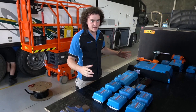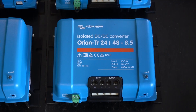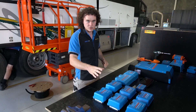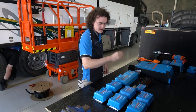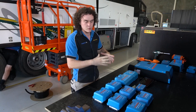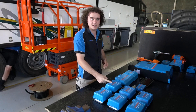We've got heaps of blue Victron gear right here. We have not one, not two, but three DC-DC chargers. They'll be taking the 24-volt alternator up to the 48-volt battery system. Between the three of them, we've got 1200 watts of charging per hour. We've got two 35-amp solar controllers, which will control the nine panels going up on the roof. Being 48-volt, we don't need to go quite as large as you would typically have to. Then we've got a 48-12 DC-DC converter.